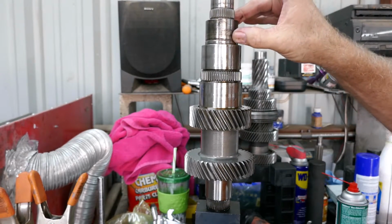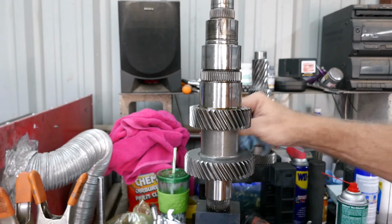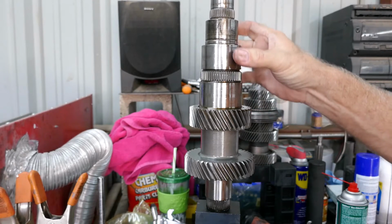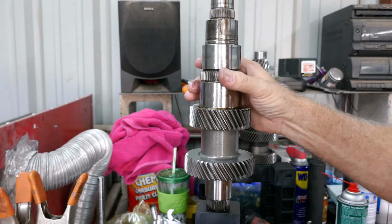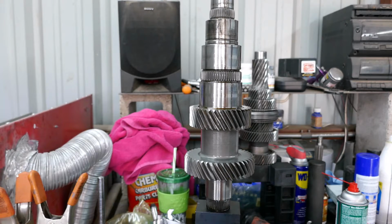And I think she looks just fine. A little bit of cleanup, a little bit of dried oil and stuff, but that's your bare main shaft right there, with all the bearings and everything out. So that's it. Let me get a couple of these gears and synchros on second. We'll go outside in the sun, and then we'll see if we can take a look at some of the edges and corners and gears.